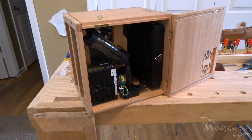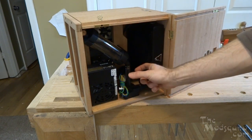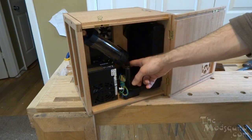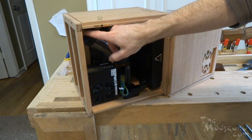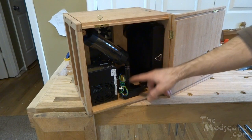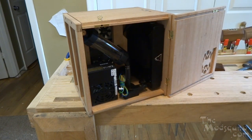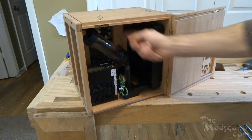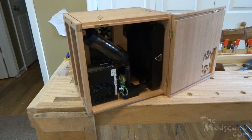You can see I have a lot of the water cooling stuff laid out and the system is pretty much installed. I did that so I could get an idea of where parts are going, and it got a little tighter than I was expecting. Trying to mount the reservoir straight vertical didn't quite work out because the power supply cables get in the way, or I can't get to the fill port which is up on top. For right now I have it angled, and I think that might be what I go with. I have an angled fitting up here so I can still get to the fill port, and eventually I'll replace the extensions with a fitting and a piece of tubing between them. I might have to make a little piece that goes behind it to mount to the uprights.